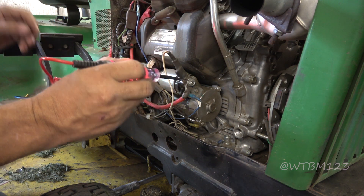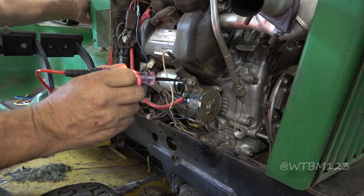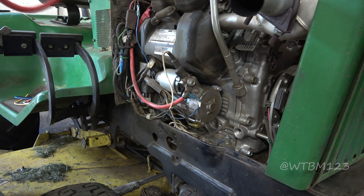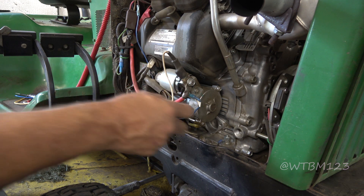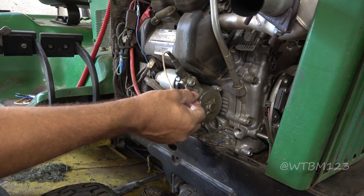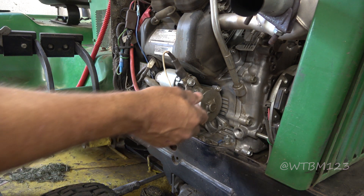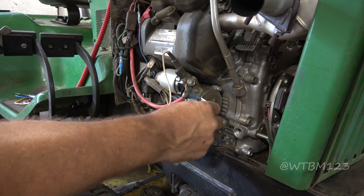Let's go ahead and see if this drops very much. See, it doesn't hardly drop at all. So we know it's not a voltage drop to here - we know it's because this wire does not always give it full contact. As long as this wire has enough power to energize that relay, this should be golden. Still, you probably ought to go back and check any fuses and connections to see if you can get stronger power here.